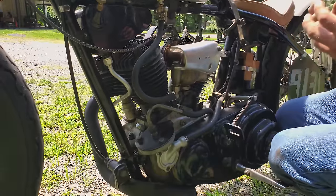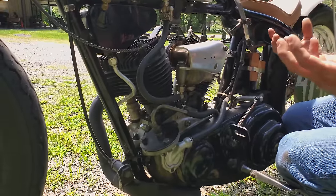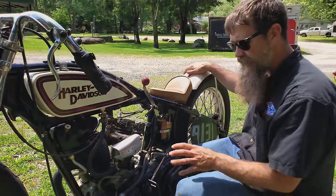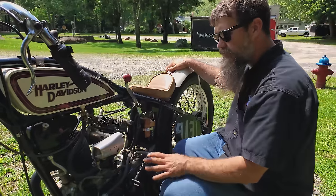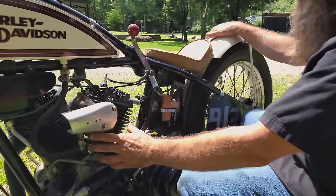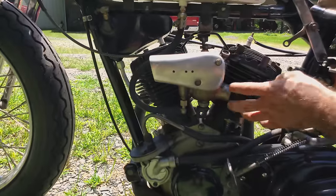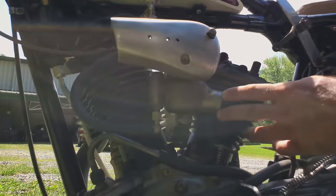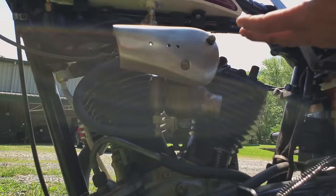What you want is negative pressure down below the cylinders — you don't want to fight atmospheric pressure when you're winding up and making this thing go. This right here helps that cause. Big float bowl: you're running wide open for duration, so this float bowl back here provides a little bit more capacity and keeps that float level higher as you go.